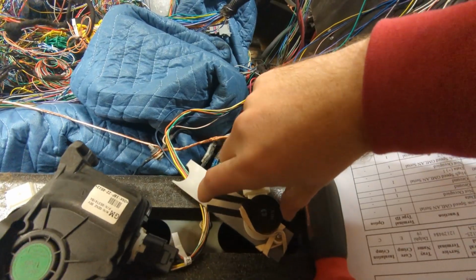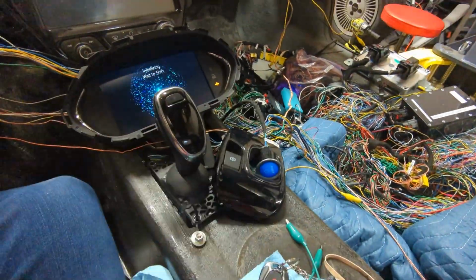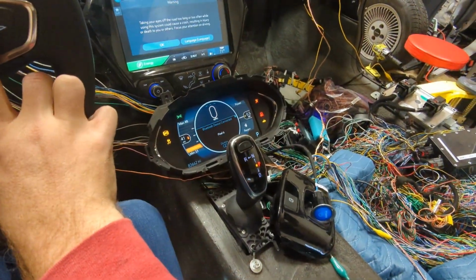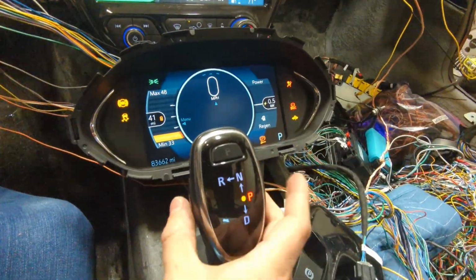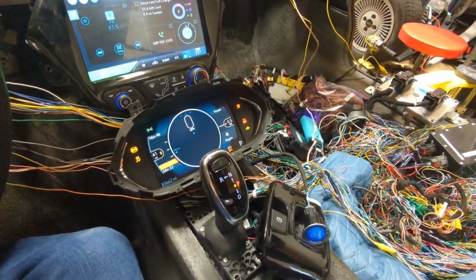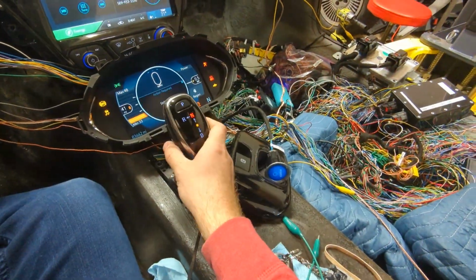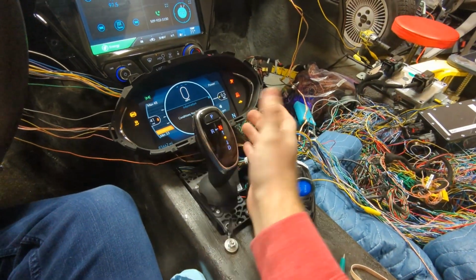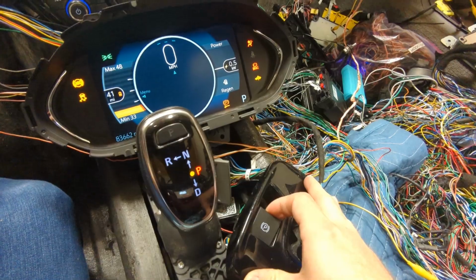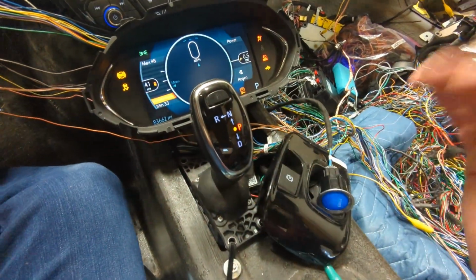And when it detects that fault, it throws a special error code that isn't cleared unless you use the code scanner to run a clear, secure, high voltage DTC function. Literally, as soon as I ran that function, I heard the contactors click closed and was able to put the car into drive and spin the motor. Here's what it looked like.